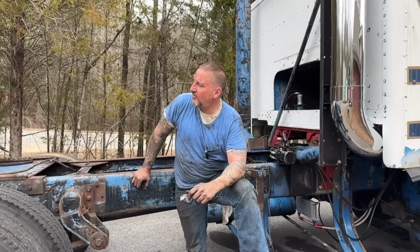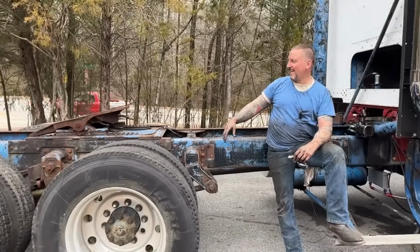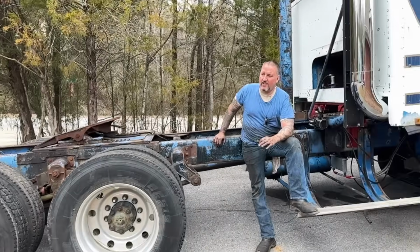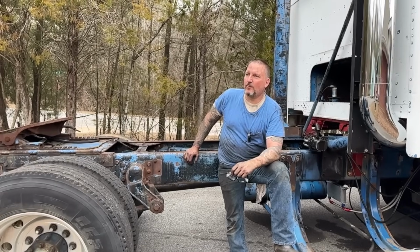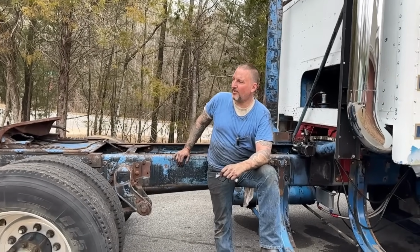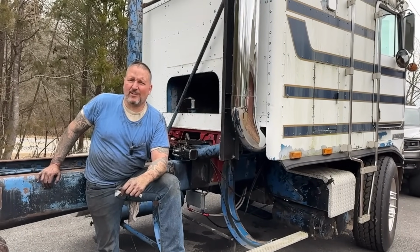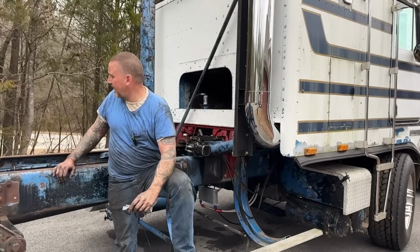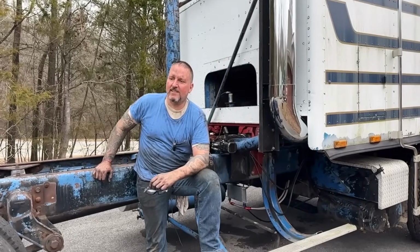Hey, what's up guys? Maiden voyage. These brakes are dragging real bad. We burned the wheels a little bit. This is really weird. In the bottom gears, it really doesn't have any power. And then once you it boosts like 9 pounds. But then once you put it in high range, this thing's got a load sense, or maybe because it doesn't have input to the speedometer yet, but it's really a pooch. A pooch initially, and then once you get into big gears, that boost comes right up and she gets up and goes.